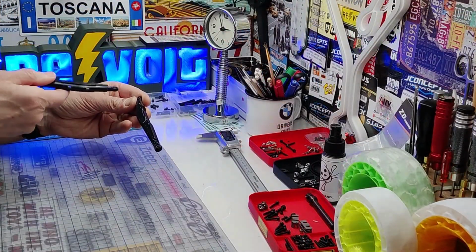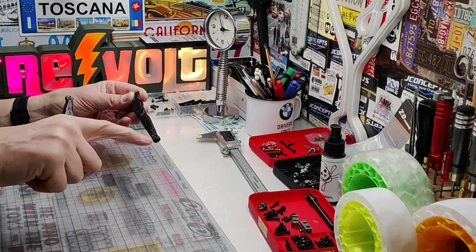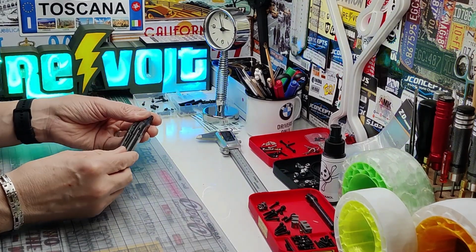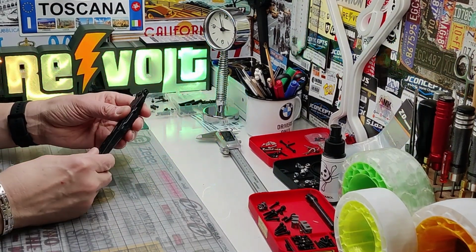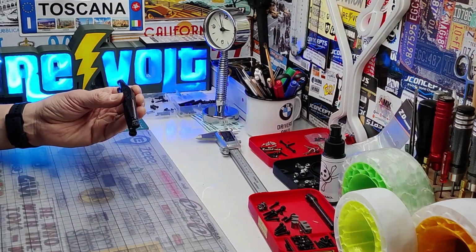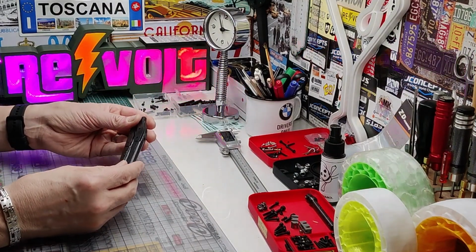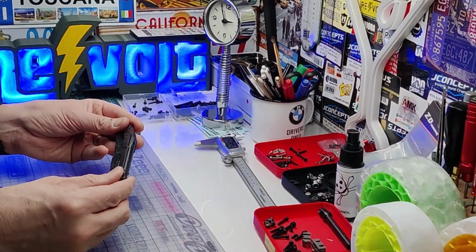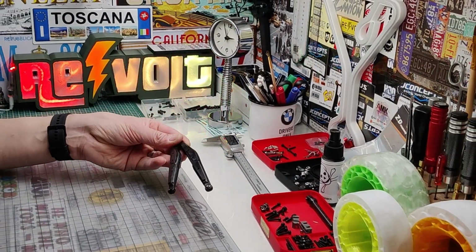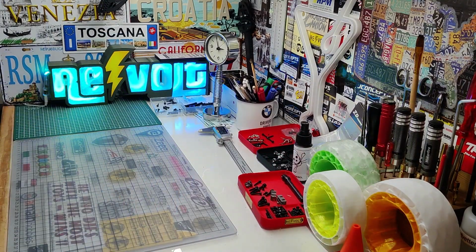They actually were mounted like this, with the car up here, so they were going down, and I wanted the other way around, a little bit of high clearance in the rear. We measured them up. The rear links, both upper and lower, are 140 millimeters. So yeah, I can make links, that's no problem, and a little bit of high clearance. So the rear will not be an issue. That will go rather fast, I think.